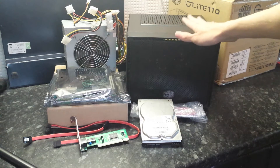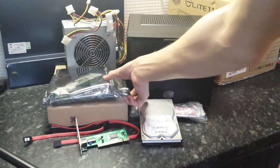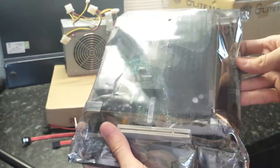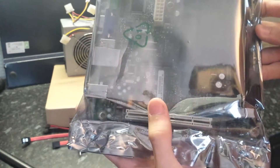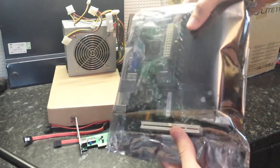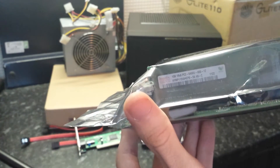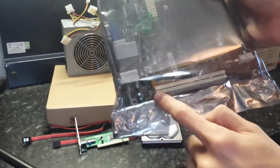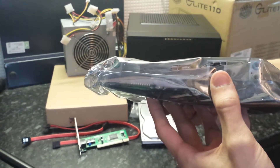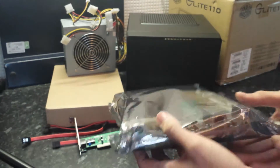The motherboard was acquired cheap off eBay. It's an Intel Desktop Board — I'll put the model number on screen — with an Atom D510, 2-core 4-thread processor. It comes with 1 gigabyte of DDR2 RAM at 6400U, it's got a PCI slot, and it's fanless so it runs nice and cool and quiet. It has onboard Gigabit Ethernet, so we're just putting in a standard card alongside that.